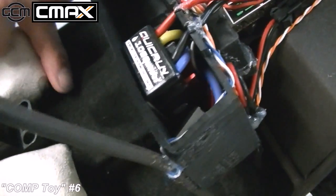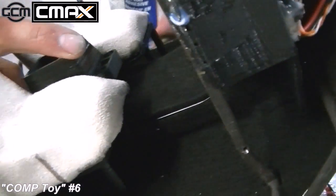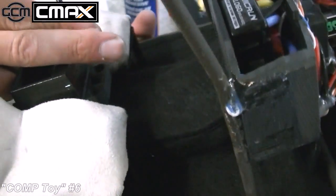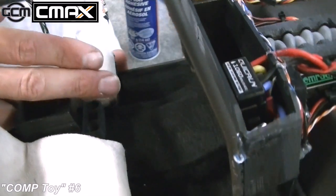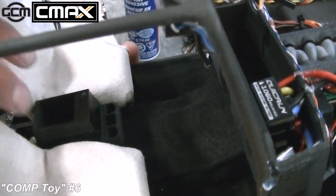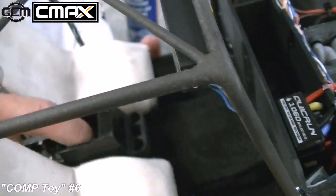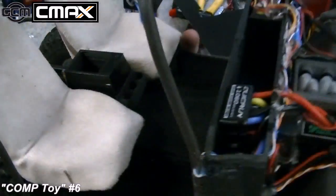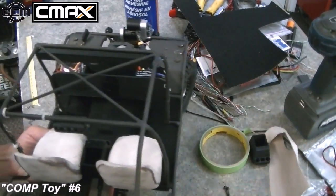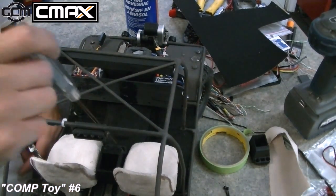We added a flat rolled extension on it that would go under the seat right inside here. And that flat rolled extension is now glued to the front piece, and being glued to the front piece, they all come out as one, and they actually sit underneath the console and seat bar. Okay, so there's 2 screws in here that actually undo the console and the seats. I'm going to take them out so you can see some of the detail there, now that you know what we're doing. And it's quite a simple process actually.